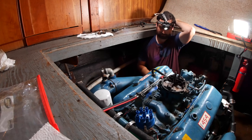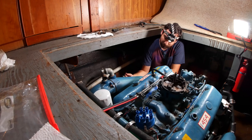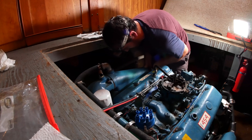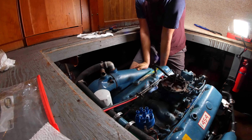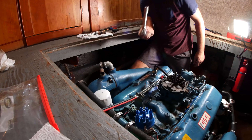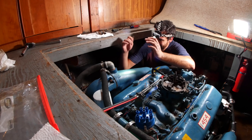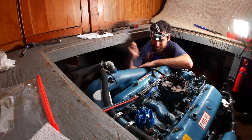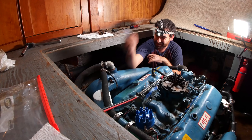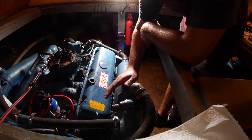I've been dreading the next step because it is messing with the exhaust manifolds. That one over there is staying; this is the one being replaced. I'm going to reinstall the one that's staying right now, get all the spark plugs on that side in. Put the new gasket on and close this thing up. This thing is heavy as hell. This is like wrestling a bull while playing chess. I have secured this exhaust manifold to the block, hooked up both hoses. Time to put the spark plugs in and route their cables to the distributor.